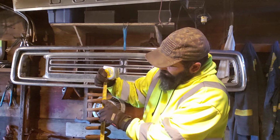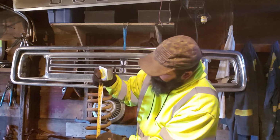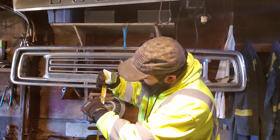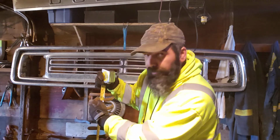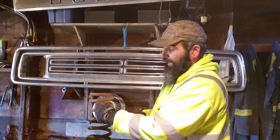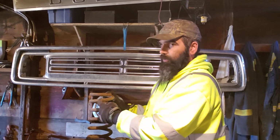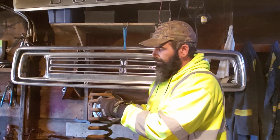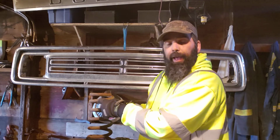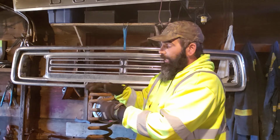So we just track around the spring until we find a spot where the top of the spring is at 11.5 inches. So actually on this particular spring, we'd make a mark right here. We'd actually be a coil and 1/8. We'd cut that with anything. Just an abrasive wheel is probably the best, creates the least amount of heat. Hacksaw, if you're feeling real ambitious, although it's hard to get in there. It turns out to be actually quite a bit on this one.